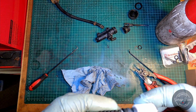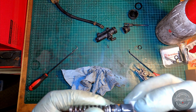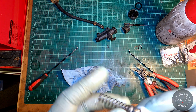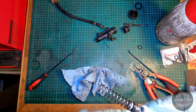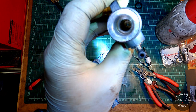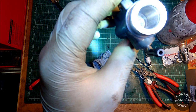The way this works is that the piston, or this side of the piston, slides in this bushing — which is maybe nylon, delrin, or some other material. But the seal here runs in the bore of the body of the master cylinder, so we could have some issues there which we're going to check in a bit. These two run just fine. Now if you look in there, it's very interesting — you can see a few black spots on the walls, almost like debris or something, which could be the cause of our problems.